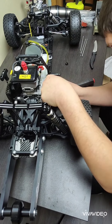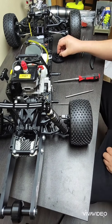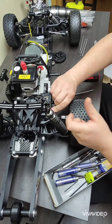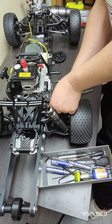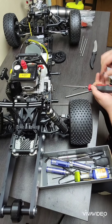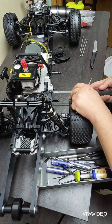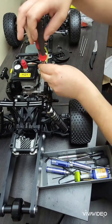Here I am taking the spur gear cover off, and also the pinion and the spur gear itself. Still taking off the bolts and pulling off the pinion gear. There are also a couple of other bolts and another cover here - three bolts that you have to take off to remove this cover.